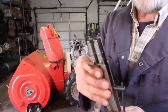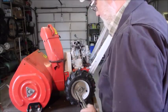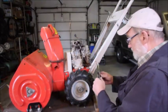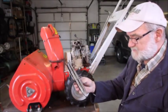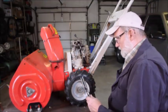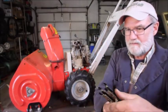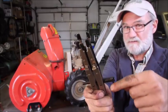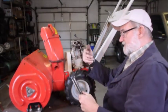Okay guys, now we're going to take that valve out. The intake valve is okay. The exhaust valve needs to be taken out and just a little bit of material taken off the bottom of the valve. George Dervidge sent me these valve spring pliers and I've used them — I have not done a video about them, but I've used them. This grabs the valve, squishes down on the valve like that, gets closer and closer, and it squishes the valve enough so that you can take the keeper out.